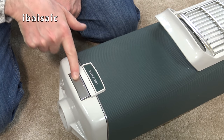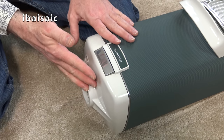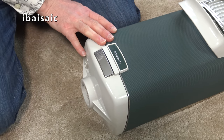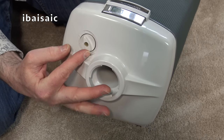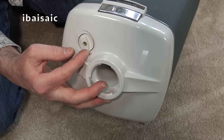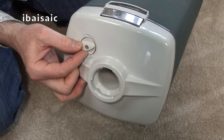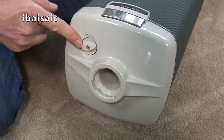Now I had trouble closing this because it's got quite a strong spring inside. So this, like some of the American Electrolux cleaners, actually opens when the bag's full - that pops open - and I'm assuming the machine will turn itself off as well. We've also got this little dial here, very common on Electrolux cleaners. That just adjusts the sensitivity of the bag check indicator from 0 to 5. So you have to adjust this if you're picking up a lot of fine dust. It'll be trial and error - I'll have to see if I can decipher the instructions.